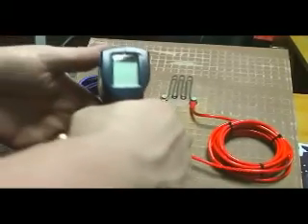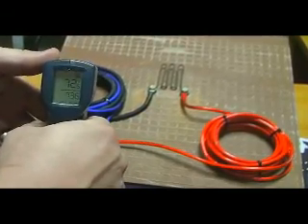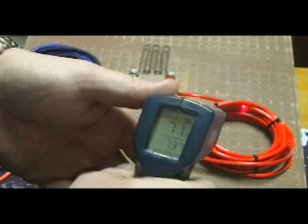To begin the demo, I'm taking the ambient temperature of both wires before the test. The HPM wire reads about 72 degrees, and the CCA wire is also right around 72 degrees. I'm plugging in the power supply to begin the test. Testing the HPM wire, we're seeing around 100 to 102 degrees peak, floating around 95 to 98 degrees.